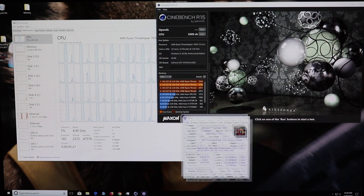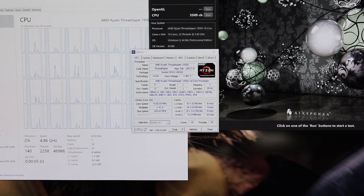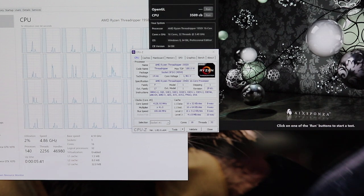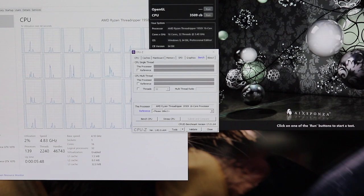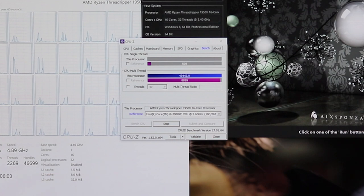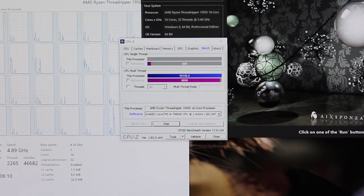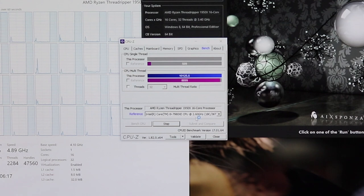Let's take a look at the CPU-Z settings — you can see your settings in here. I got the 4.1 multiplier applied. It shows 1.461, which is a little bit different than what we put in because of the offset, so make sure you put in the offset I showed you in the BIOS and not this number. Over to the CPU-Z Bench — this will also determine if your system can handle the current settings. We'll throw in the Core i9 18-core as a comparison. Surprisingly, I'm just able to beat the i9, just surpassing 10,000 on the benchmark. However, the Core i9 is at 2.6 gigahertz base clock, so once you overclock the i9, it's going to slap Threadripper right in the face.